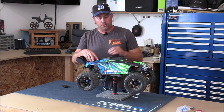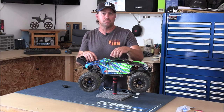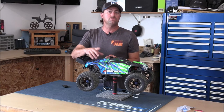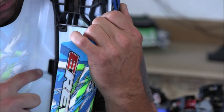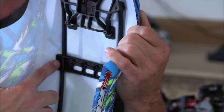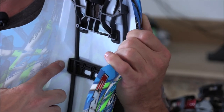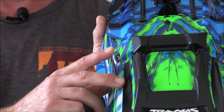I chose to go with the air scoops on the back here. I'm going to drill this hole as high as possible to get the most amount of air out of the cab. Let me show you underneath what's going on, because there's a mount for your endoskeleton that you're going to want to miss. After you take the cover off and look inside, see how close this mount is for your endoskeleton? We don't want to drill through that. I'd recommend drilling from the inside out to get a good pilot hole first so you can miss it, then flip it over and drill the rest from the outside.